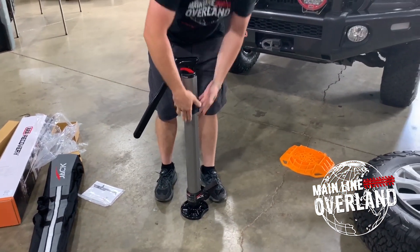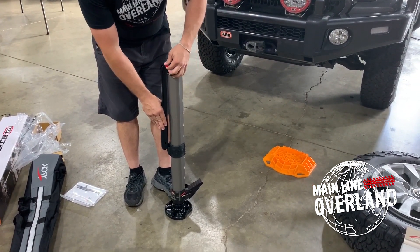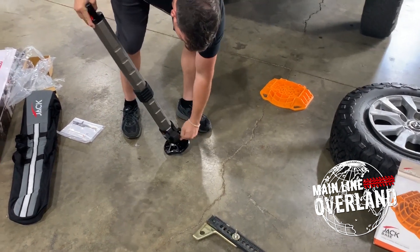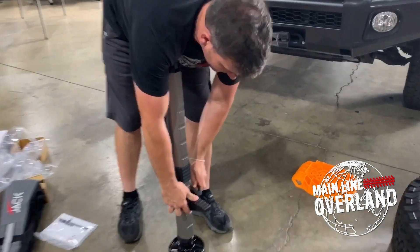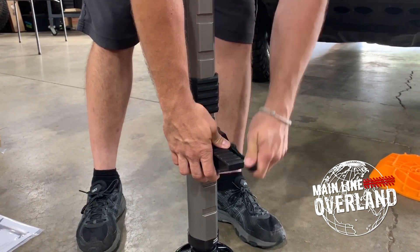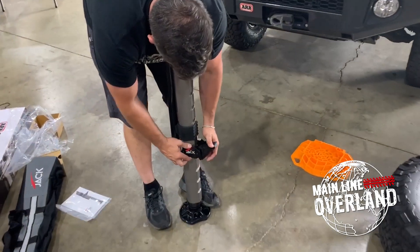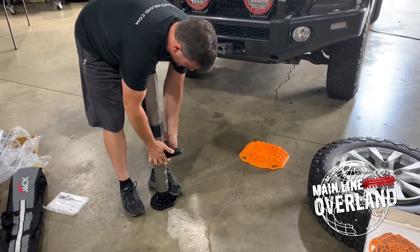The main pieces I can determine: it's a hydraulic setup with hydraulic oil inside. We have the handle that raises and lowers, and a release device that has two stages — a minor stage and then a deeper stage for lowering quickly. This articulates a bit and you can use this to raise and lower the base height for the jack. You can lock that out and then use this little piece — it's almost like you'd have on your bicycle — to hold it steady. You could probably twist this a little tighter for a firmer hold. Crank it down and close. This will give you your initial height on where you're going.